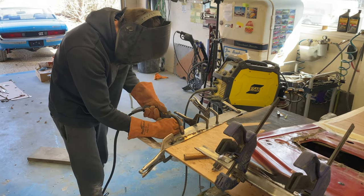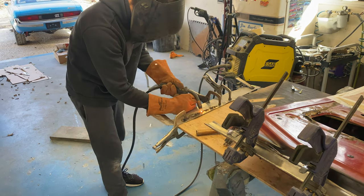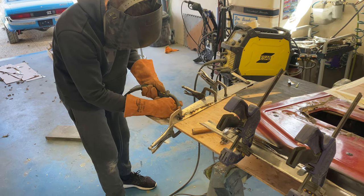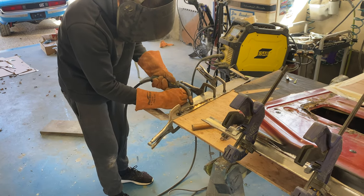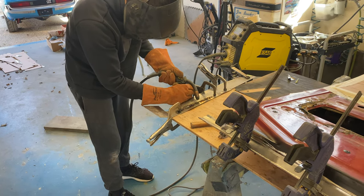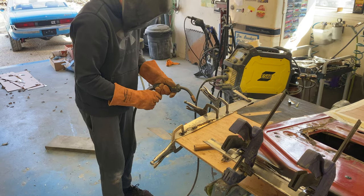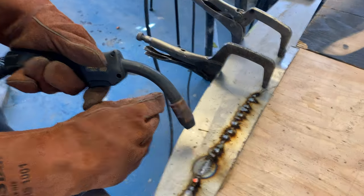I just taught my brother how to do spot welding. I know there are a couple of viewers who said my welding sucks — but here's what you may not know about auto body welding. You cannot run a continuous bead with a MIG on 18 gauge. You've got to space them out. I go about an inch and a half to two inches and keep filling the gaps, moving across the panel. Yes, it won't look pretty, but if you want to warp your panels, run a continuous bead. If you're running thick material you can control heat a little better, but for auto body it has to be done that way.